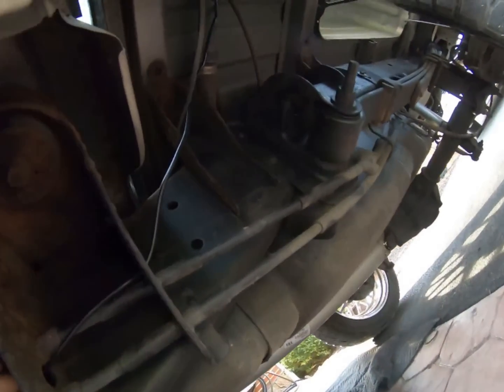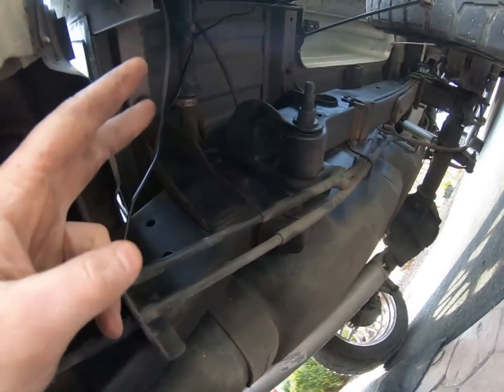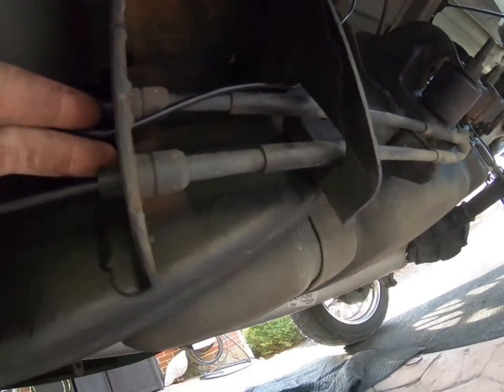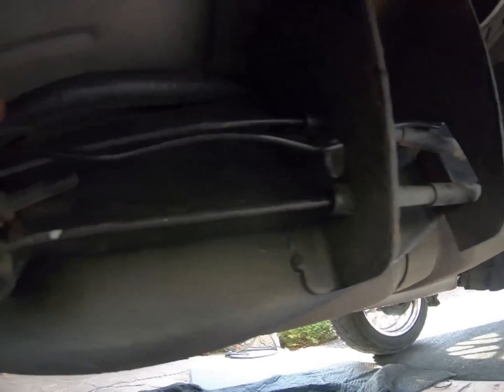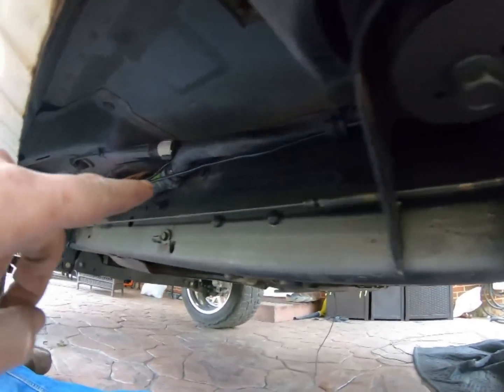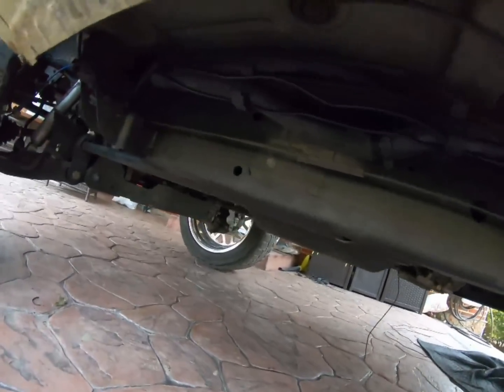So you see here, this is the wire. It runs up, so that way you don't see it. I got to cut the ends off the zip ties, I know. It runs through right here where the e-brake bracket is, and from here it starts following the harness. I literally follow the wiring harness all the way up to the front. And the same goes for the other side.